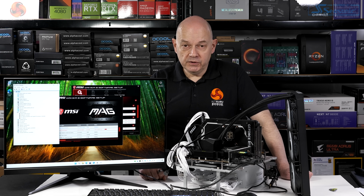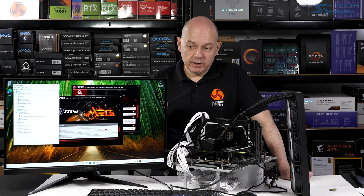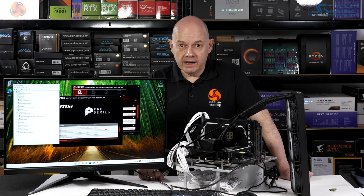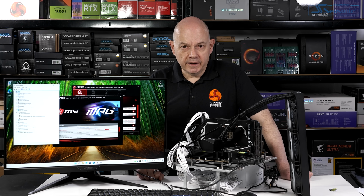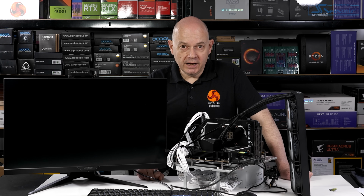And for me, for a few days, the power plan was utterly critical. However, at some point things changed, and I think it's when I installed this beta driver pack, when I was doing motherboard switches from one MSI to another. Suddenly everything was absolutely fine. I thought that Windows 11 24H2 was utterly broken on this new platform. I think it's something more subtle than that. I think it's some driver, possibly to do with the management engine. But something somewhere is doing something very strange, and I'm sure you'll hear that from a great many other reviewers as well.